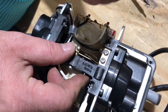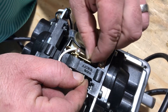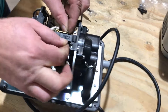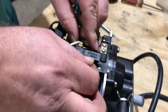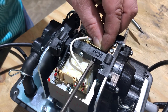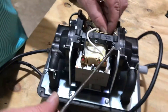And this little nylon nut drives you nuts sometimes. Take the nylon nut — this is going to be a little difficult, but once you get it started it's easy. Getting it started is the key. Now we got it started, so I'm just going to take my flat head and screw this into place. There are two sets of threads. A lot of people think they've got to get to the second set of threads — you don't. Once it gets past that first set of threads and it's nice and tight, you're good to go.